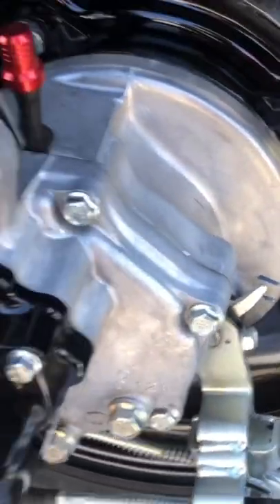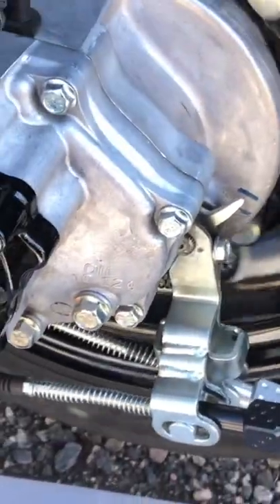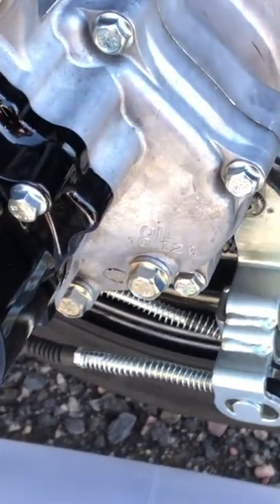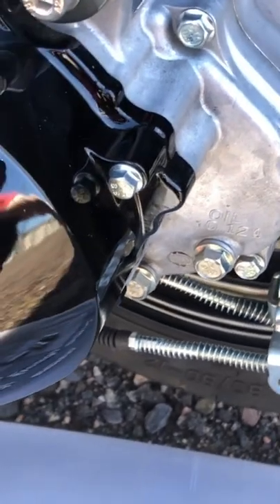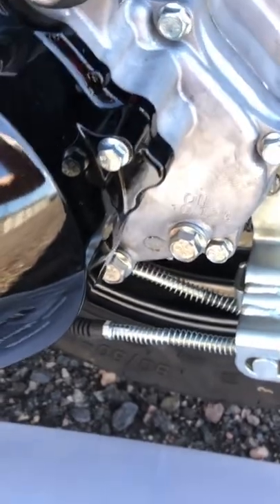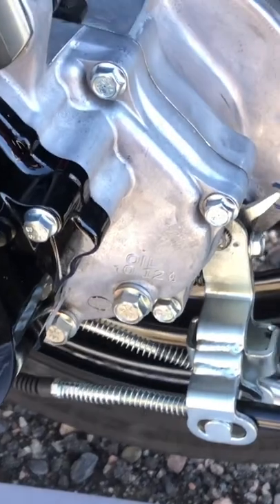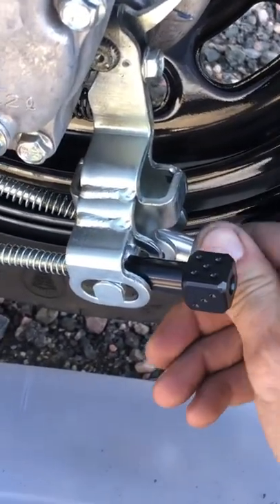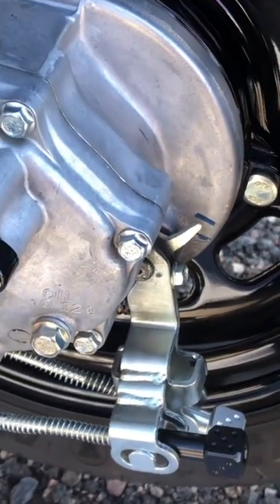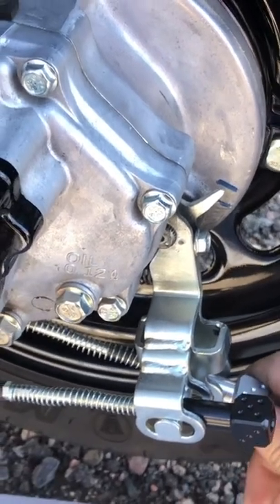For the adjustment, you can do two things. You can either have it on the center stand and physically roll the tire as you push on the foot brake or parking brake to make sure it's rolling freely — then as soon as you start to squeeze it, it engages and stops. The other way is to have the bike running and set the idle just high enough so the wheel free-rolls while idling, and then literally as you're turning the adjuster, you turn until you can hear it, physically feel it make contact, or see it slow down.